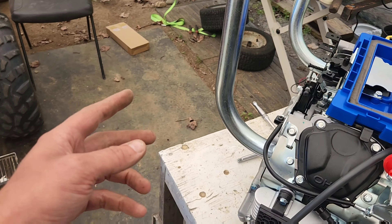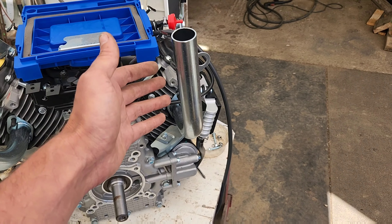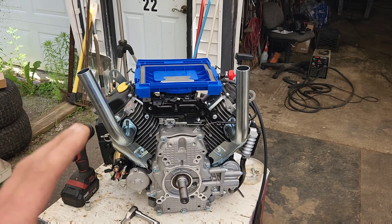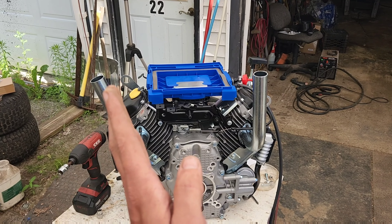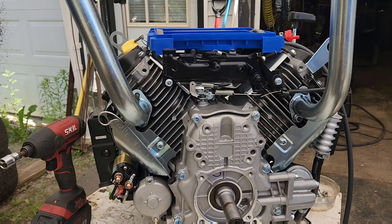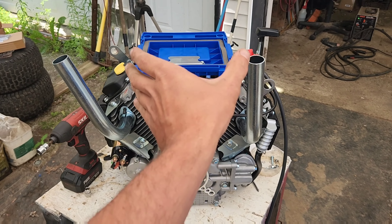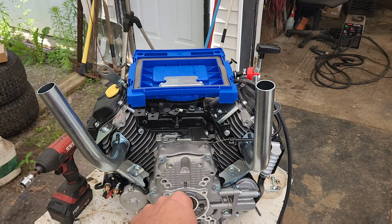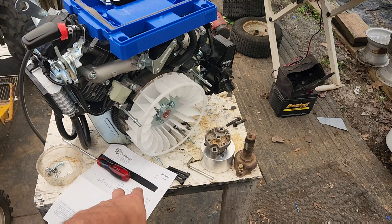One more note to add: these are generic Honda GX390 headers. As you can see, they bolt right up perfectly. But one is tipped slightly sideways because the bolt pattern on the back of this is just slightly canted to the top — see that stud is a little bit over to the side. No big deal. With some basic welding skills, you slice that off on the straightaway, clock it a little bit, and it's good to go. So we have our adapters in order to adapt to whatever exhaust system we decide to put on this. I'll include a link for these, and if this works, I'll have a link for this in the description.